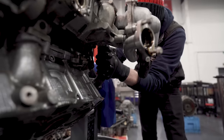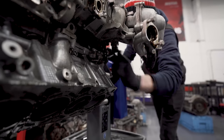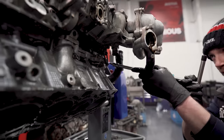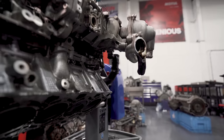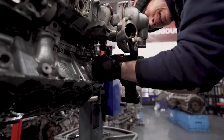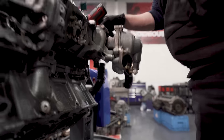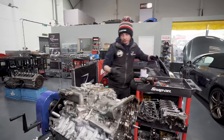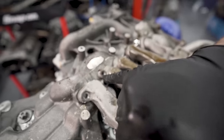And then I just need to, the hose comes off. Lovely, like so. Loosen the supporting bracket for the oil pump, which is a T30 there. All right, and then we can literally buzz that out. These 13 top ones. Right, so there's two dowels here and here. So when you put the bolts in, those dowels go in and they locate. You just see them there, look? And then there's one there.